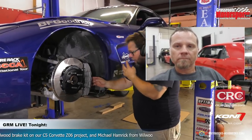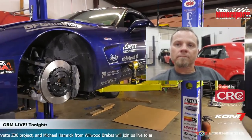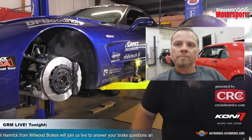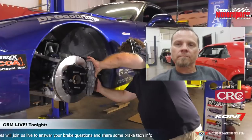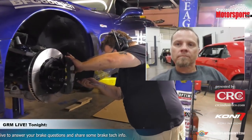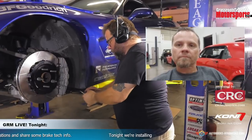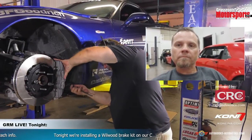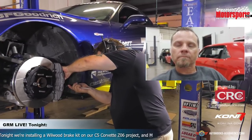Now I'm not going to bolt that on yet. What I'm going to do first, though, is just give a quick peek and see if we're even remotely close. And if we're way off, we'll move our shims around. But if we're close, we will bolt this down and measure for real.